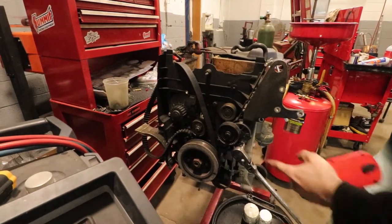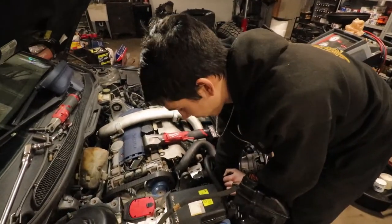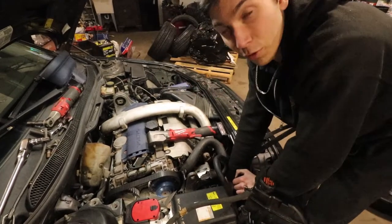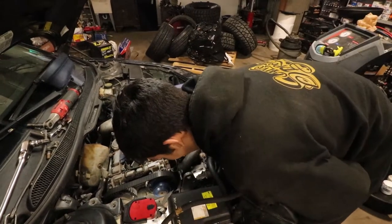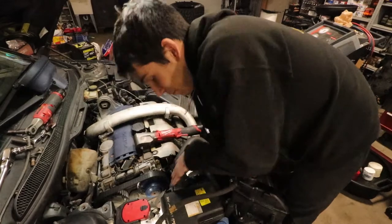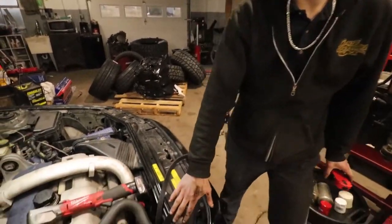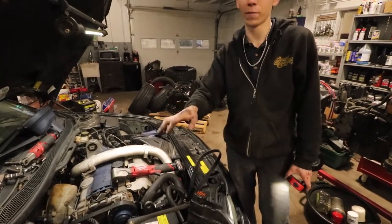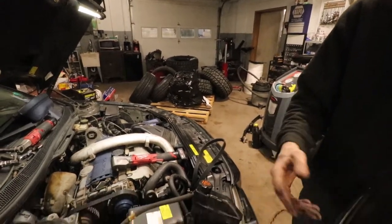All I'm going to do is go down on it and it'll release tension. Now would be a great time to replace your serpentine belt. I'm going to blame Corlin — he forgot to tell me to order one. So I will not be replacing it today but I will be replacing it soon. The serpentine belt doesn't need to come off the AC compressor, so we're just going to leave it. Next step, get the car up, take the tire off.